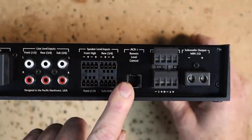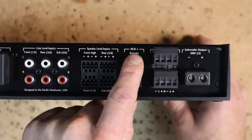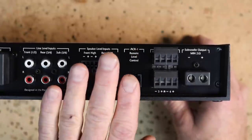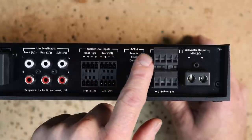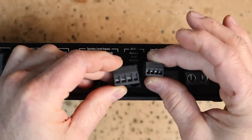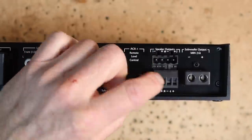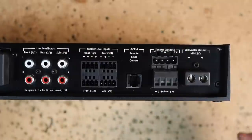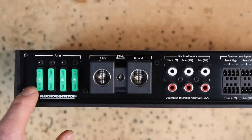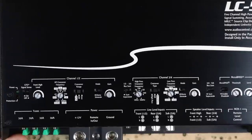There's an input here for a bass knob — the top tells you which one you'll need, which is the ACR1. That's another great thing Audio Control does: it tells you which bass knob you need. If you have the D amplifier, you'll want the ACR3. The outputs are over here — they're a bigger connector so you can't confuse them with inputs. Your front, rear, and sub outputs accept up to 8-gauge wire. Your power inputs accept up to 0-gauge and it has four 30-amp fuses. The remote turn-on is in the middle.